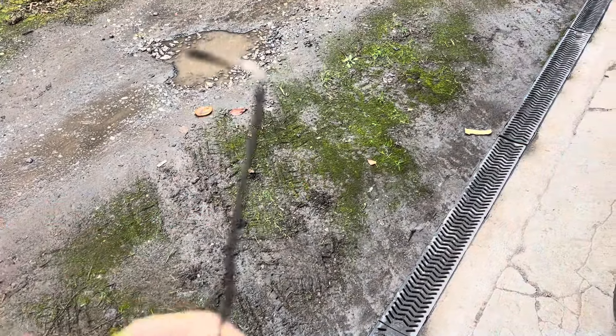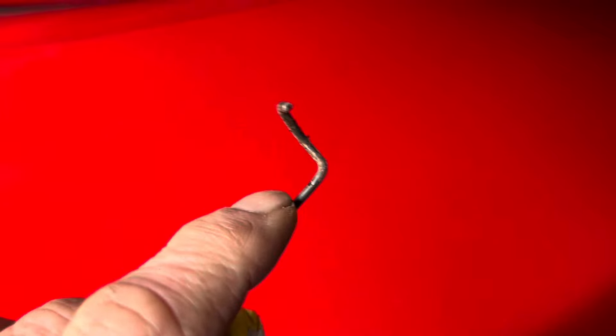You can use a piece of coat hanger to do that, but I would suggest putting some electrical tape around it so you don't damage the edge here. If you're struggling to get the hard top off, sometimes you can get a set of mole grips around here and twist it through 90 degrees so that it's no longer hooked under — but nine times out of ten that is rusted solid and won't move. If you have enough friends you can potentially lift the hard top with four people and move the whole hard top around 90 degrees to unhitch it, though there is a large chance of scratching the car.